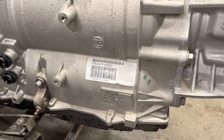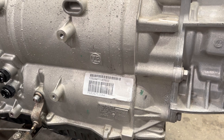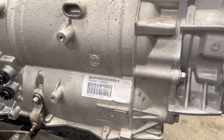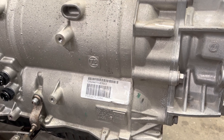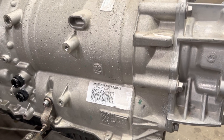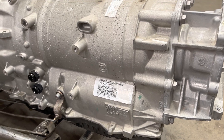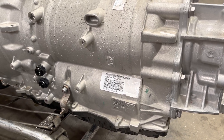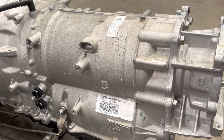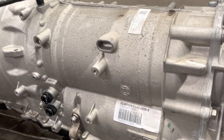Here's the thing I've been learning: the HP70 is standard, the HP75 seems to be an option. So a lot of people got the 75 as an option for whatever reason, but mostly these are standard transmissions. The 70 is standard, but it's really kind of a hit-and-miss deal because you don't know — you've got to get the VIN and find out if it's got a 70 or a 75.